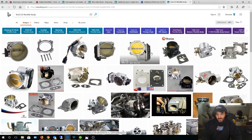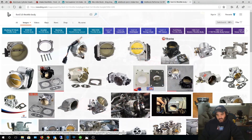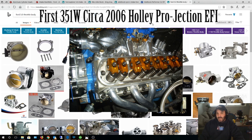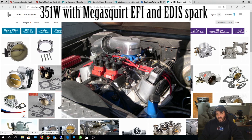The 289 with a supercharger was actually pretty cool. Since the 289 is a short-stroke engine I could really rev it to high RPMs. But I damaged the blower up in Big Bear when my truck overheated — the Roots-style B&M 144 rotors were scuffing each other as it spun. After that I took the supercharger off and started thinking about a 351 because I wanted more torque. The blower was awesome on the street but not really ideal on the trails.